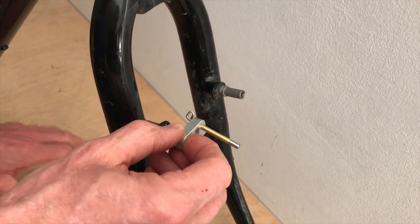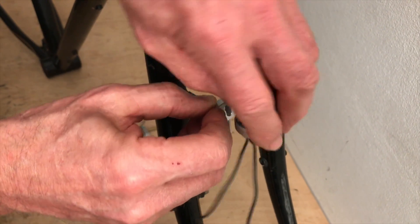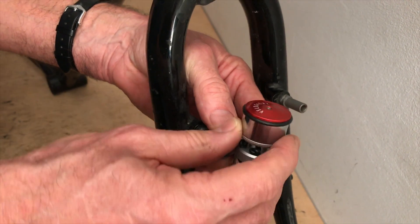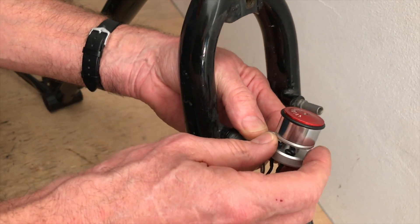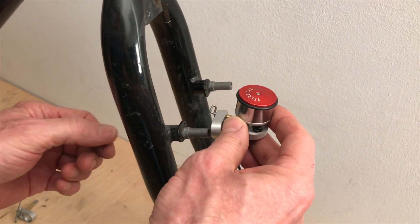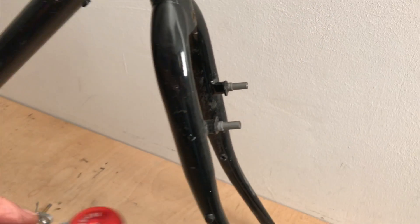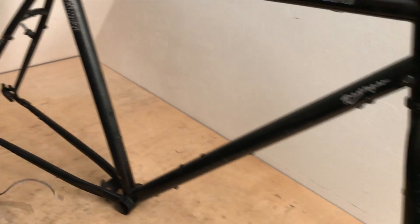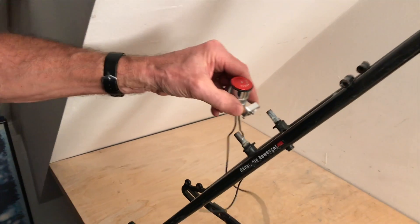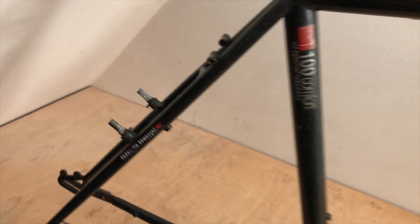That's the same mirror inverted. The dynamo would sit like this. The brake socket holder on the right is also used on bikes much smaller than 26 inches — it has a slightly steeper tilt. You can mount the brake socket holder in each case also to the rear, but then on the other side respectively. That means the front right holder can also be mounted on the rear left, and also the other way around of course.